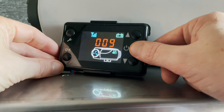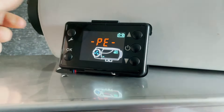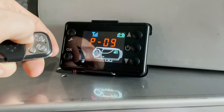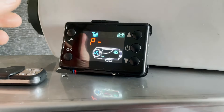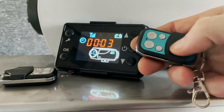Press this button to go back to the main menu. Next, you're going to want to pair the remote. To pair the remote, press the spanner and up buttons at the same time until you get 'PE', then press the off button on the remote — and that will pair it. You can actually pair two remotes to this one controller, so press spanner and up again and pair the second remote to it as well. Now they should both work.